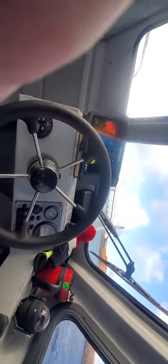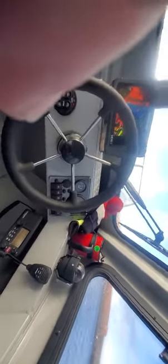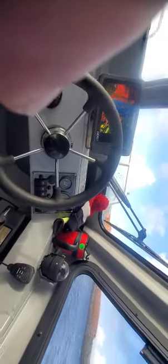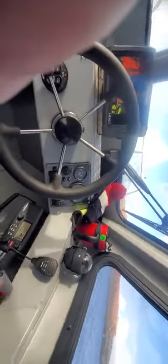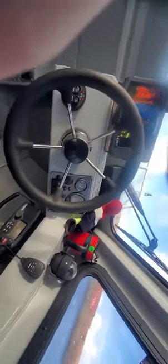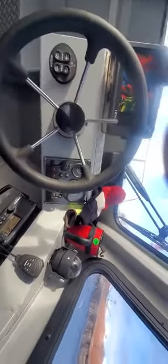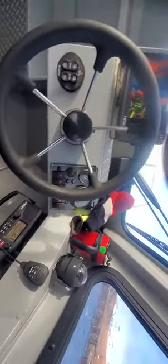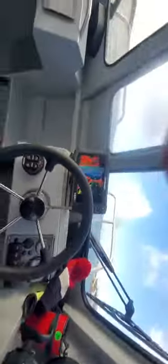Out of the hole I hit it about four seconds planing at 4,000 RPM doing 19 miles per hour. Cruising is about 20 mph. At 4,500 RPM this is going to change a little bit when you change the prop. Wide open right there is about 5,800 RPM — so drop it to a 15 pitch.